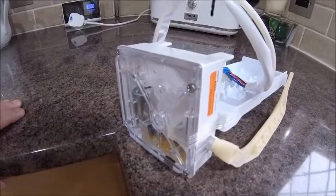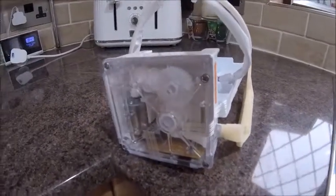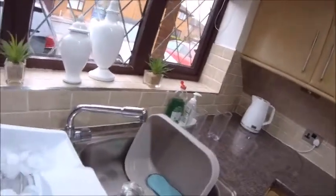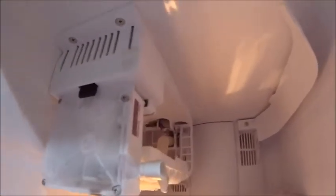So I'll take the ice bucket out — I've got to drop down a panel at the top of this device and put the new one in. To get the ice bucket out it's pretty easy — there you go. That comes out like that. As you can see, there's the module itself. The water's fed in right at the back there, and the module pretty much pops out by pressing up and giving it a pull. The only thing I've got to do is take off that top shroud because that's where the wiring is — there are screws there, and probably some hidden at the back. Let's get the screws out and see where that takes me.